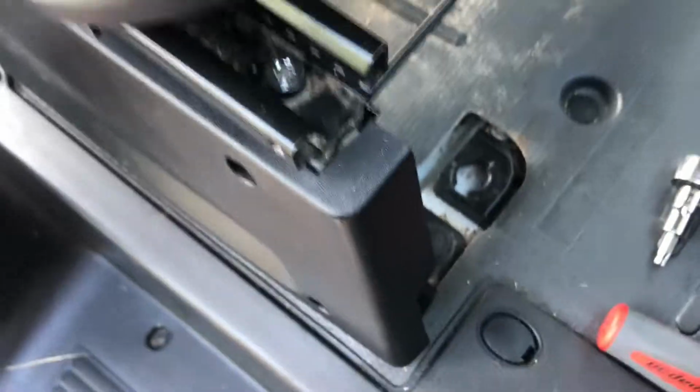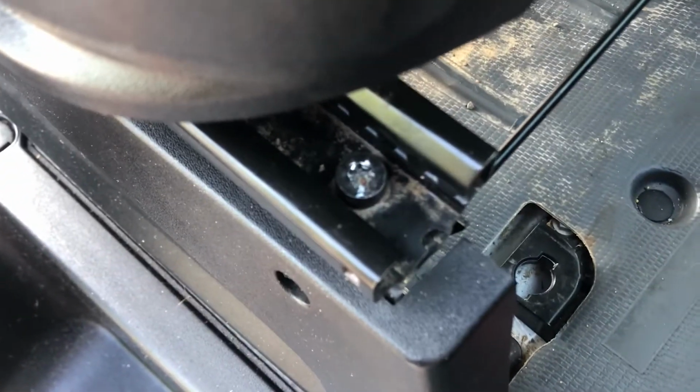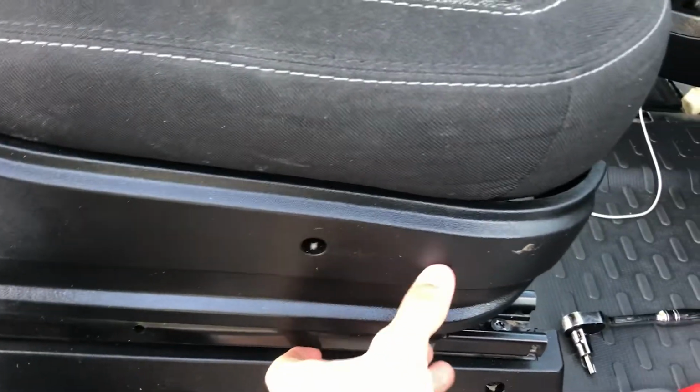We're learning. I want to show you something cool though that I just found out. So down here on the two front access points to these star bits on the seat, I was gonna go and undrill these screws to pop out this plastic covering. But what I found, should have looked before I went to go get the drill, there's a clamp right there. And what you can do is unpop the clamp right underneath the seat, this piece, and then you'll have enough access to unscrew that.